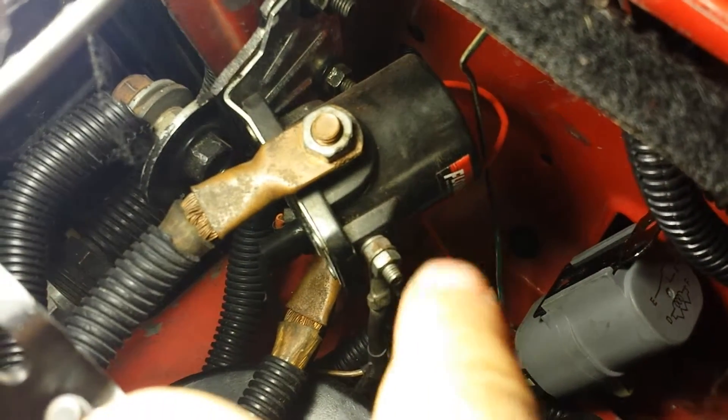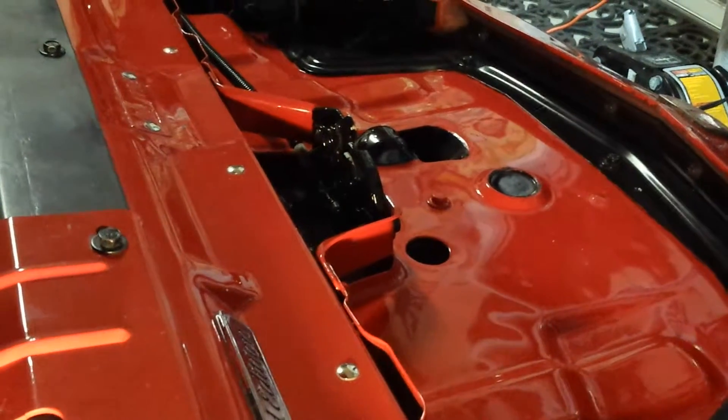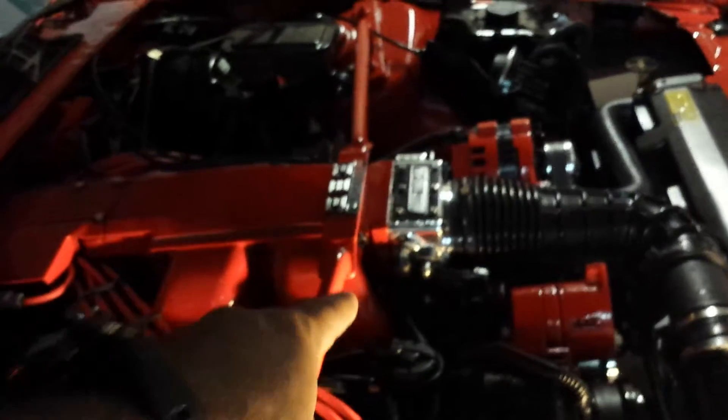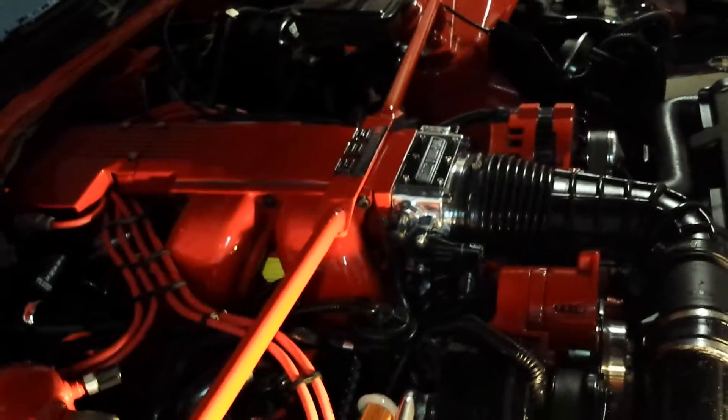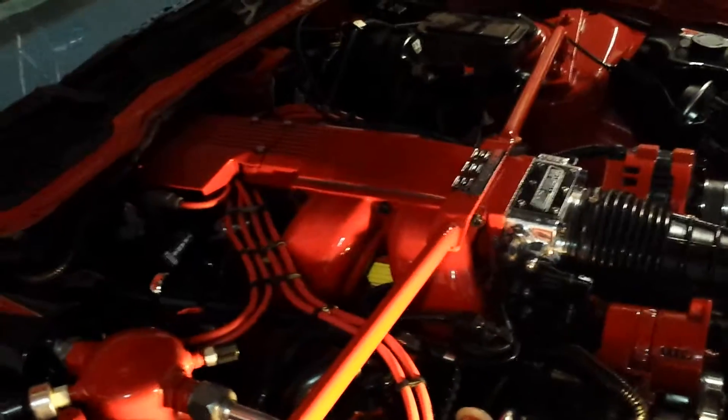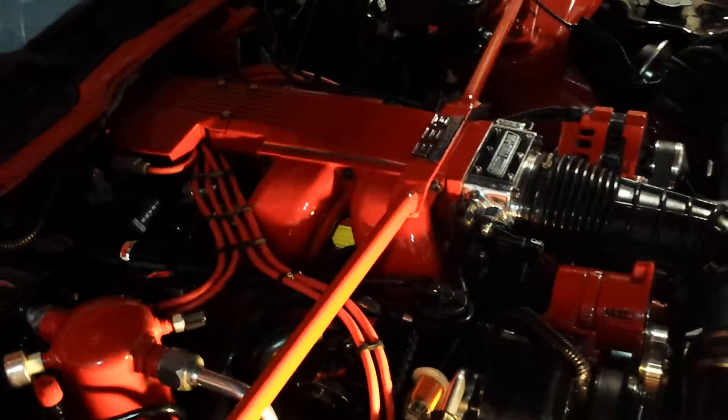You'll notice down here there's a brown wire with a red wire spliced into it — that's a power wire that runs up and powers the transmission cooler fan I showed you earlier. I just spliced into that factory wire; that brown wire is simply a power wire when the key is turned on. So I've got three fans running off two relays in factory format, except for those three wires. The transmission cooler, the throttle body bypass, and reconfiguring those wires to keep the fans running all the time has significantly reduced engine operating temperatures for my 383 stroker engine. That's pretty much it — thanks for watching.